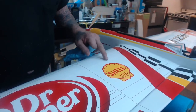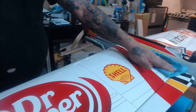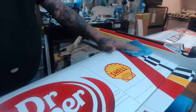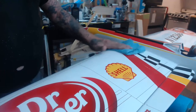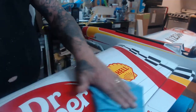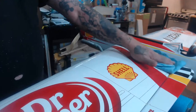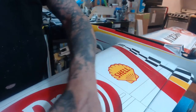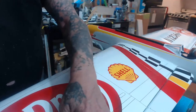Right up here, it looks like acne up there. Well, I got to sand that out and polish it up. And remember, I got to do this all on the bottom, too. Exactly the same thing. That's coming out pretty good. I kind of waited till I got back here when I had this stand instead of trying to do it on my buffing pad on the bench so that I could stand up and kind of look over it and see exactly what I'm doing. We got 20 people watching me buff an airplane. Are you learning anything? That's the big deal.